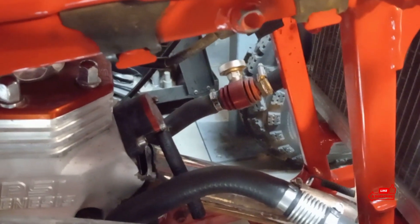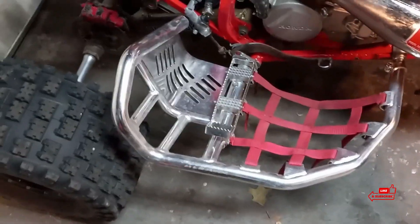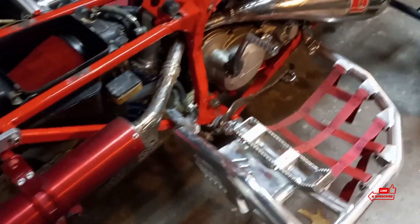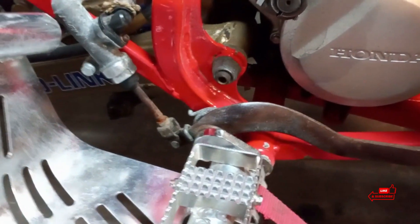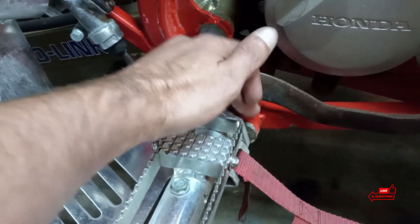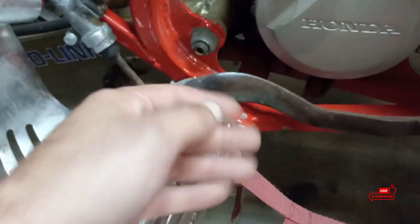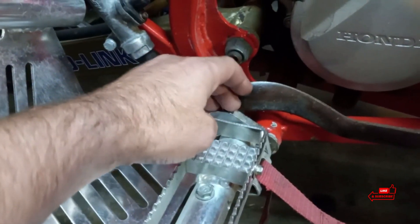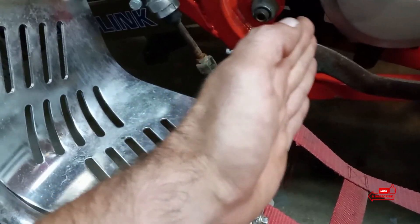It's got an aftermarket rad with some pretty crappy radiator hoses and a temperature gauge. I got to polish the face of it because it's all oxidized. We got these Team Alba Racing Pro Elite Nerf bars on here. I believe whoever put these on didn't get the correct ones because these foot pegs on the stock 86 — 86 and 87 has the two-bolt pattern. 88 and 89 has more like a dirt bike style that goes right to this bolt hole here, so they flip up. The rear brake pedal goes through there.